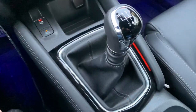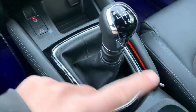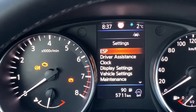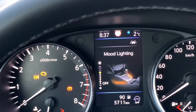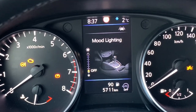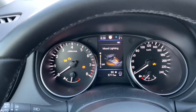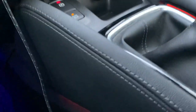So yes, there is a possibility to add this ambient light yourself, but you have to be a little creative. On the Qashqai itself you can only use the orange color, but within the settings there is a way to adjust the brightness. You go to vehicle settings, then lighting, and there you have the mood lighting where you can brighten or dim the light. I'll dim it all the way now — and when I brighten it you can see it coming through. I'll put it on the default mode for this really nice soft effect.